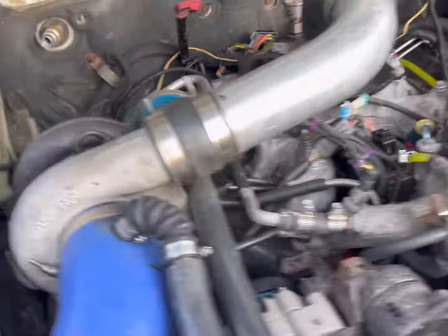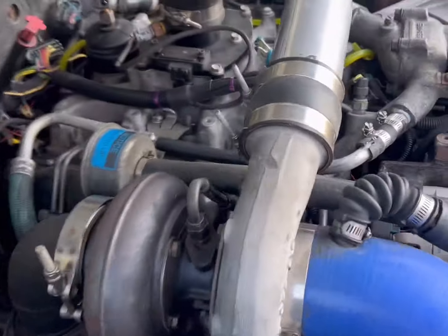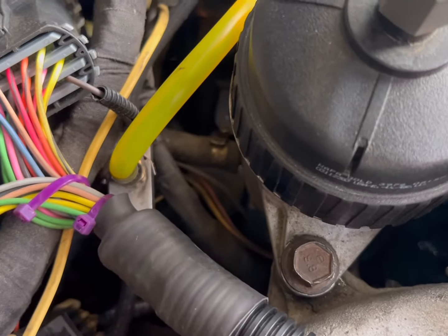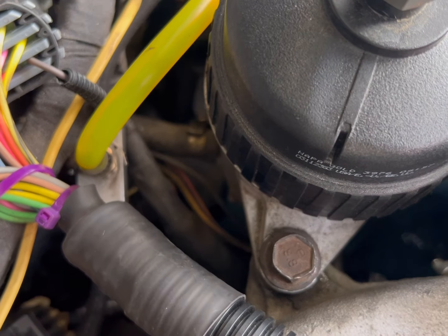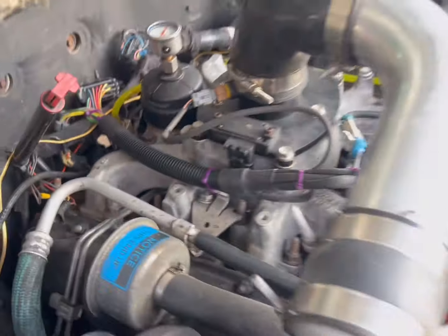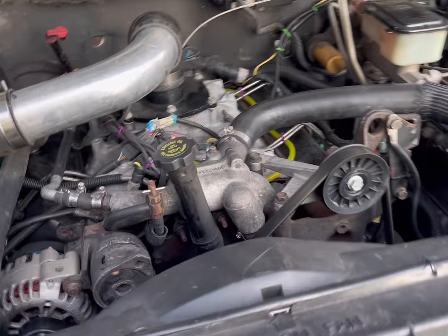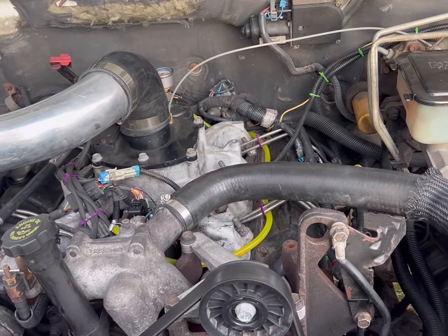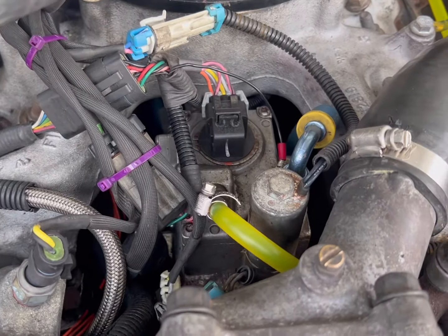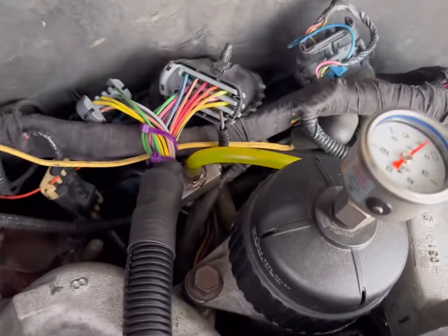Here's our new line that runs across there. There's no great way to mount this billet return block, so I just kind of have it chilling back here with everything else and have it zip tied in place. As you can see it doesn't go too bad being installed like that — it tucks right behind your stock filter head. If you don't have a filter anymore that works even better. But there's our new injection pump harness that runs around to the back, our billet return that runs there, and I ran it all externally.